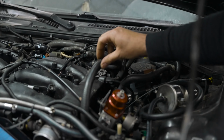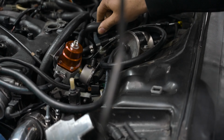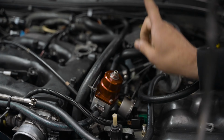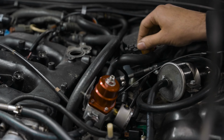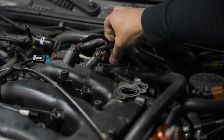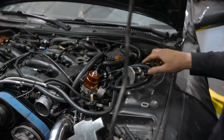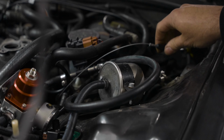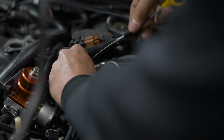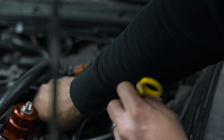We've got some hoses that are kind of out of place. This fitting here is for the clutch booster. The twin turbos have a clutch booster. You can see this fitting is just pointed straight up, so that needs to be fixed. Some of these hoses are cracked. This one doesn't even appear to be the factory style hose. You can see the routing for the flex fuel sensor. All this stuff needs to be cleaned up. The dipstick tube, I think, doesn't want to play nice and go back in. So that's going to be fun.